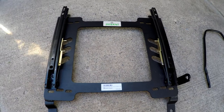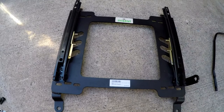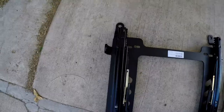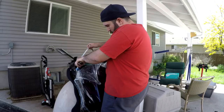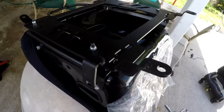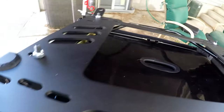Here's the seat bracket with the universal sliders. I'm going to assemble it and see how high I sit with the sliders on. I'm going to loosely assemble it so I can still play around with all the angles and where everything sits exactly, and when I find a good spot I'll fix it all together. I loosely put four bolts in and pushed them inward as close as possible so we know it will make it onto the bracket. Once it's all tightened and fixed in place, we need to bolt it to the seat. To do that we have to slide the sliders back one way then the other to get full access to the holes. One thing to keep in mind: keep making sure it's straight because they're slots, not holes, so you can shift them side to side — make sure it's lined up properly.